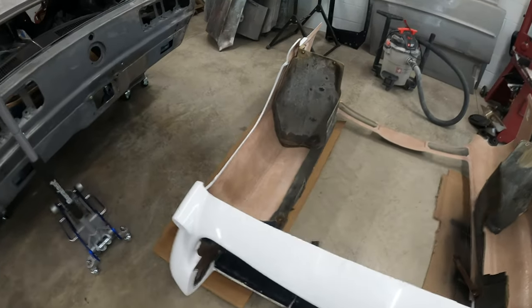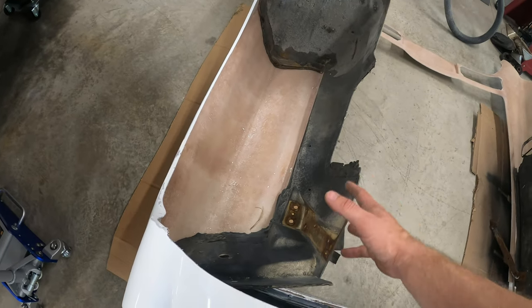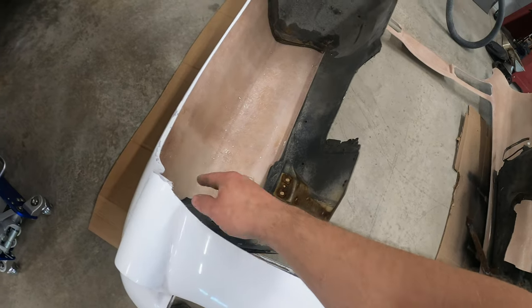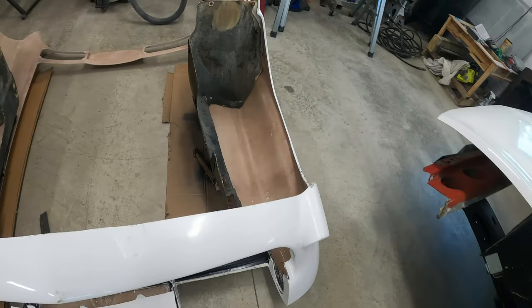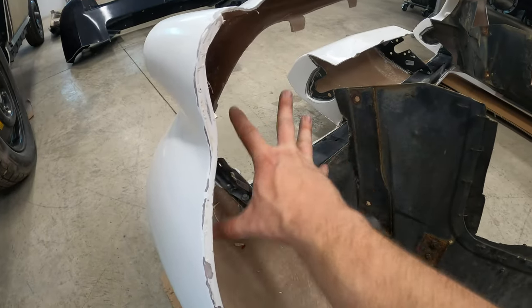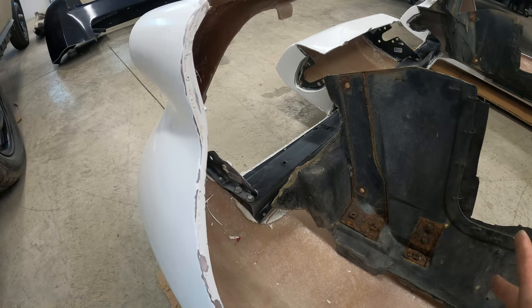I have the front end flipped upside down to set in the inner fenders. This one fits pretty good. I need to grind all the adhesive out, but it's fairly obvious where this locates. Once I get everything roughed up, I'll trace out a line for where I need to rough this up to accept it. This inner fender on this side needs a little bit of repair work — there's a lot of stuff that goes right here that's not here, so that's a little bit of a problem.